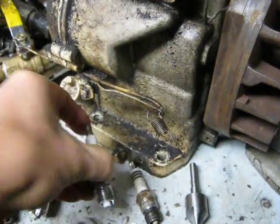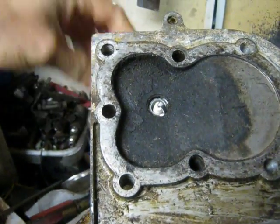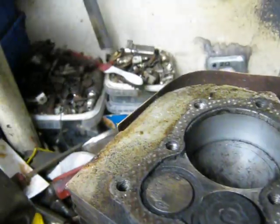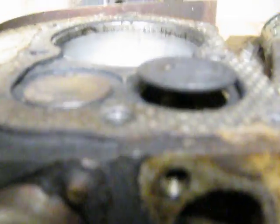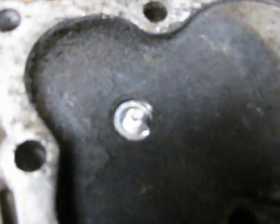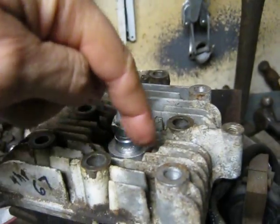The other important thing you've got to do is mark the spark plug where the ground electrode sits, because it's important that you clock it correctly. You can't have the ground electrode by the intake valve, or the intake valve will hit it — at least on these 5-horse Briggs. The spark plug sits right about where my finger is there, and as you can see the intake valve opens up a fair amount and will hit your spark plug. So you have to have it clocked right — pointing away from the inlet valve.